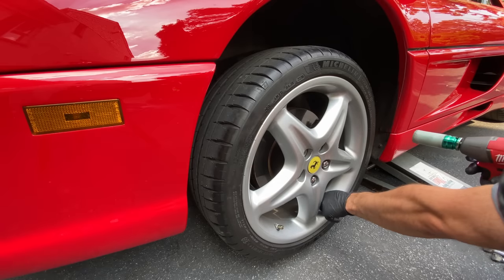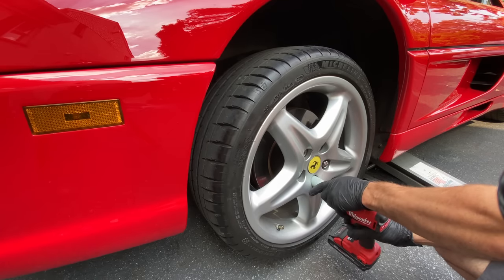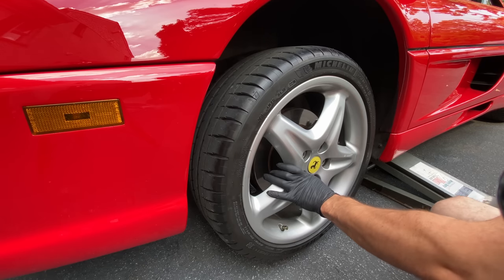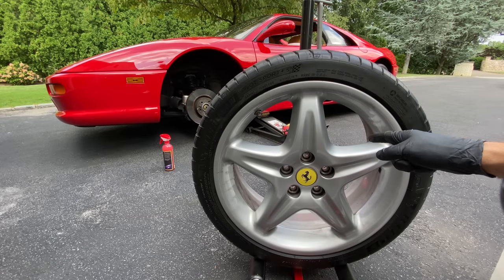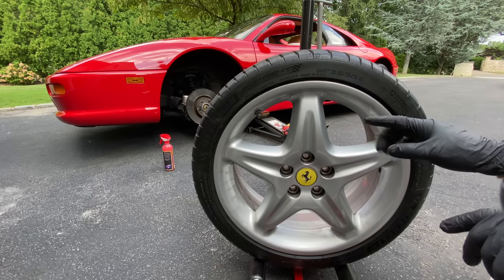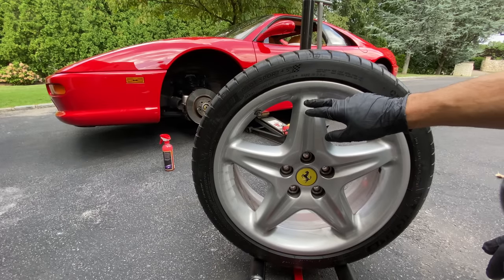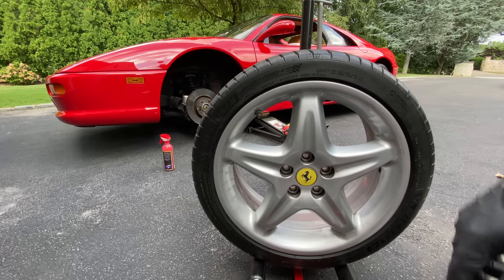So there's also some sticky adhesive left from some wheel weights over the years, and I'm going to pull that off as well. Okay, so usually the last one, you hold it. There we go. Pop the wheel off. Get started. I have the wheel stand from the Source Garage that I'm using today. The reason I'm using this instead of a smaller one is because this wheel and tire assembly, when you stand it upright on the ground, it wants to tip over towards its face. So I really don't want to risk having this topple over and damage a very expensive classic Speedline Ferrari wheel.